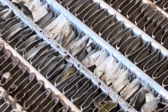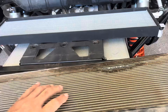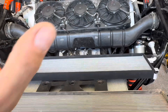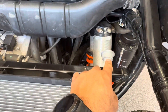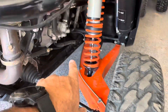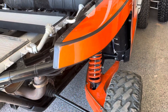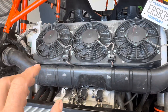We had an oil line rubbing up against it — let me get in here close. You can see the holes in that row right there: it wore through it and water ran out of the system. That causes inlet air temperatures to go up and the car to go into limp mode — frustrating on a trip. What was happening is I was putting water into the system and it was exiting through here. We had it dripping down, and there were times I had it parked on a hill trying to burp it, but we had water leaking out.